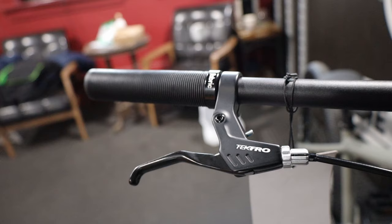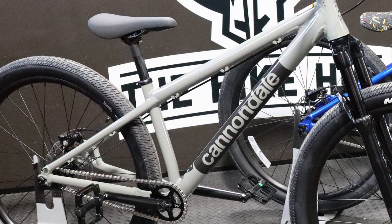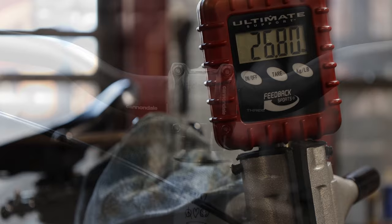As far as geometry, this bike will favor a taller rider with the 438mm reach. The chain stay on the other hand is nice and short at 378mm. There are other factors when it comes to geometry, but I would say this one falls in the size large category. If you're an average sized rider, this will be a more stable platform if you're transitioning from a traditional mountain bike. I have to say I'm also impressed with the weight — with chromoly cranks and a half-linked chain and several house-branded parts, this bike comes in at a fairly light 26.8 pounds.